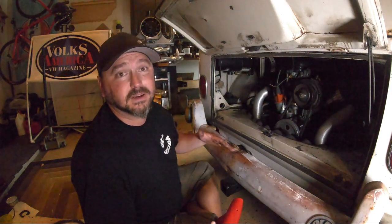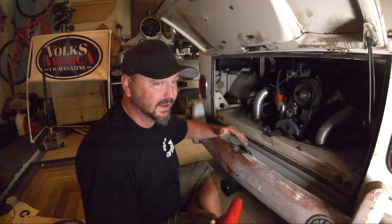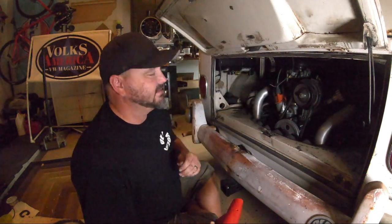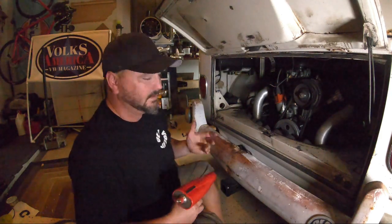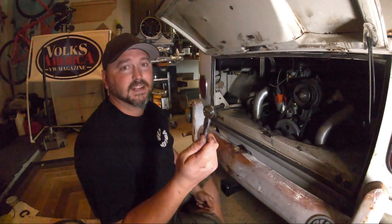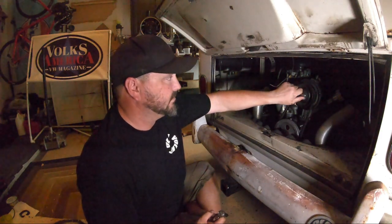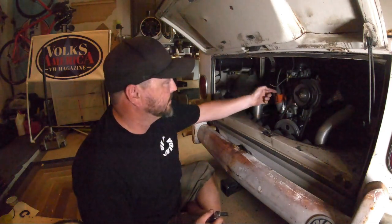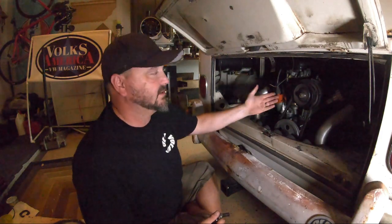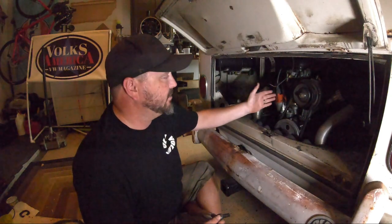When we go out to Havasu we cross the continental divide — it's pretty high elevation — and then come all the way back down into the desert. You kind of have to make those adjustments to make it run right. So get yourself a good timing gun and a 10 millimeter ratchet — that's really all you need. A wrench helps if you really need to replace the distributor: turn it until number one lines up with the rotor, then follow the steps to adjust timing once the engine starts.